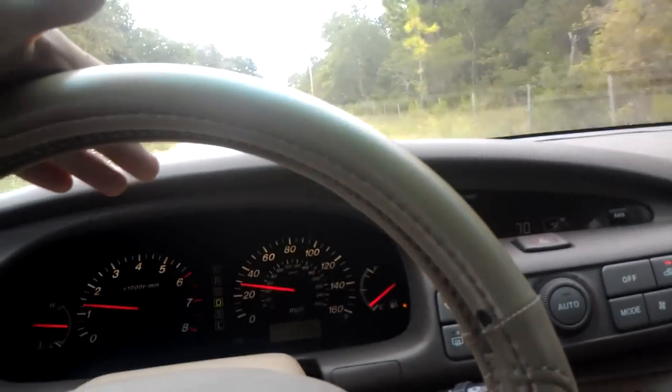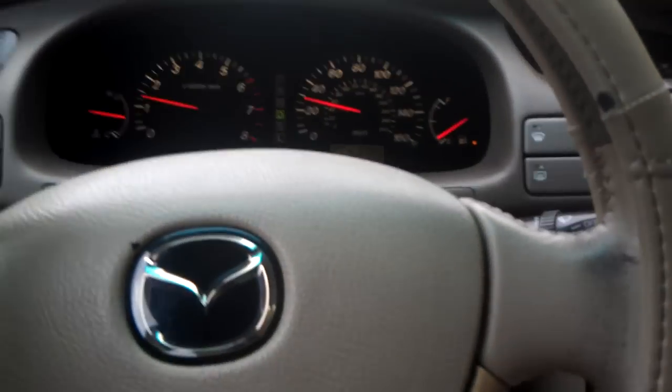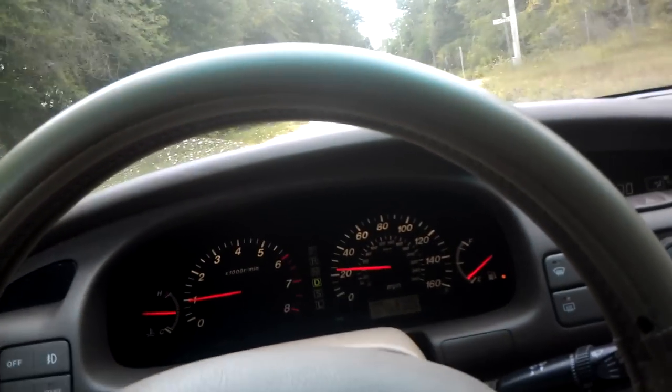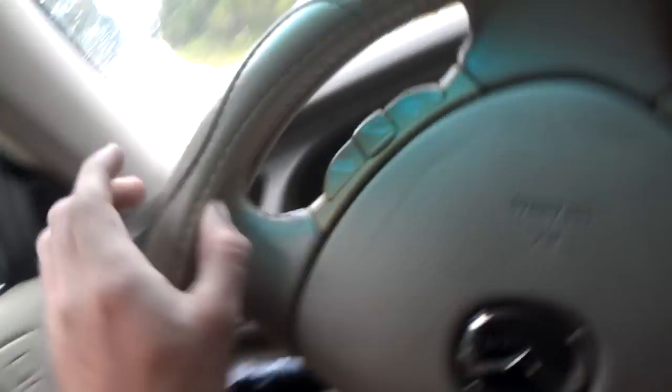Which of course relays right back to here. So in this case, the front wheels, since it's front-wheel drive, if they're spinning faster than the rear wheels, it will initiate the traction control system, a.k.a. TCS. What it does when traction control is initiated is it will cut the power going to those wheels to slow them down until they reach the same speed that the other two wheels are traveling.